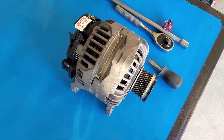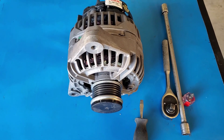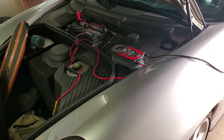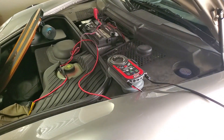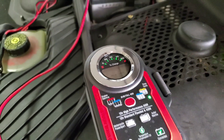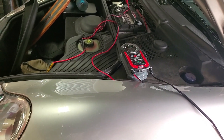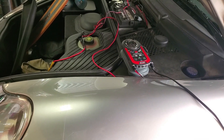Here's the new alternator that will soon be going in — it's not actually new, it's the one that I rebuilt in another video, you can look that up on my channel. Let me walk through the steps I took to establish that my problem was my voltage regulator. First I checked my battery to see if it was charged — it was completely dead. Then I charged it to see if it would take a charge, and it came back fully charged. So I know now almost without a doubt that the problem is my voltage regulator, because my gauge on the dash was showing overcharge. That means the alternator is working just fine but the regulator is not regulating the voltage.